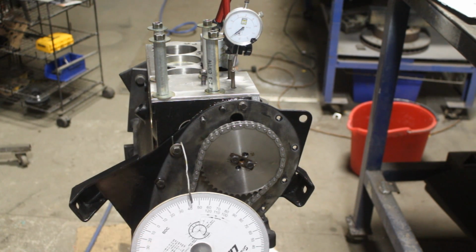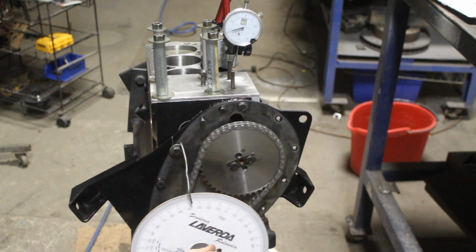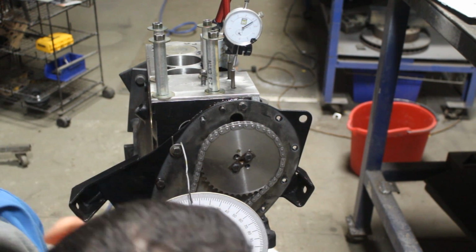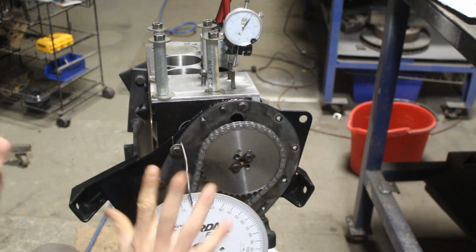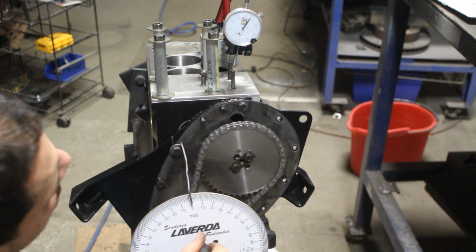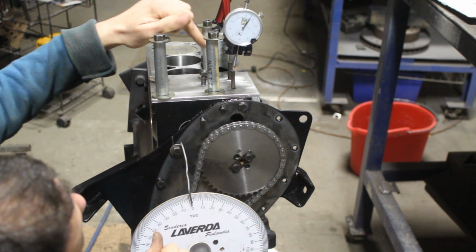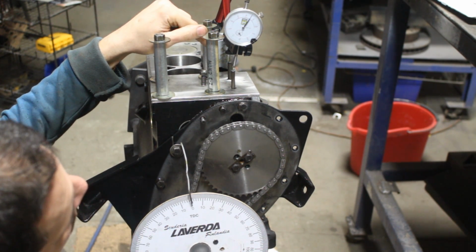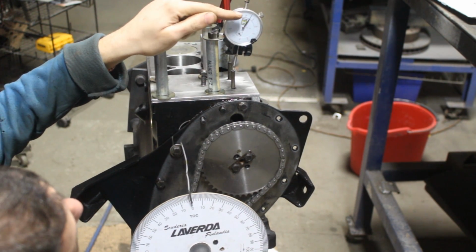Zero. So now we're gonna go past top dead center and we're gonna approach it in the clockwise direction. Okay, that's 45 and a half, so not 44 and a half, 45 and a half. Okay, and the intake is 40, so the center point between them is 43. So if we bring it to 43,